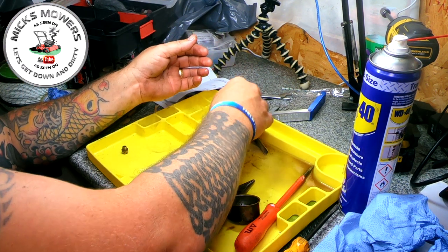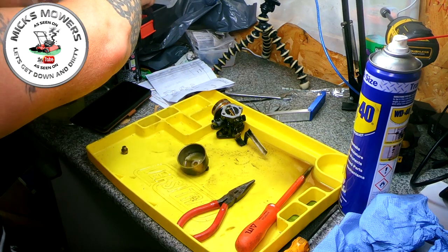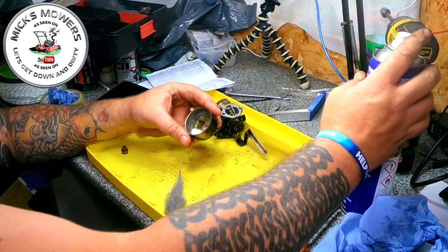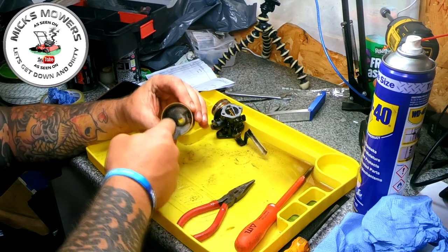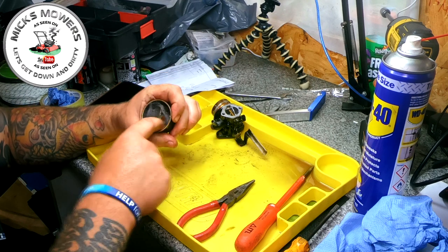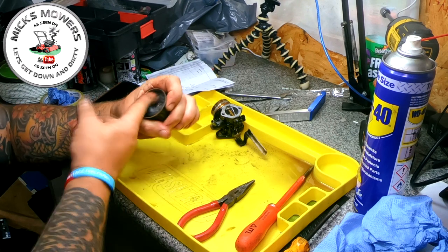That's working fine. Now, the problem's going to be this little tiny bleeder that floods the old carby. That's going to be the problem because they do leak. Now, what I did with the last one I had, I just used a bit of that aluminium stuff, welding rods, because that broke on the other one, and I had to aluminium weld it, and it held. I've done the job. There's a bit of gunk in here. I just want to go a bit careful around this bleeding valve. And the bowl's in good condition.